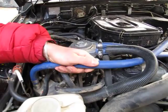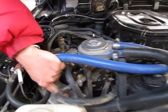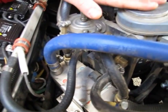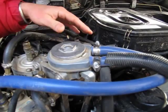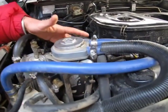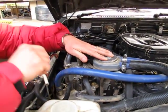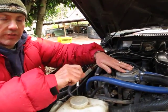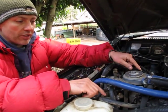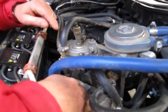Once the engine is warm, I use the coolant temperature from the engine to heat a heat exchanger and also a secondary filter — this is a fuel filter for the vegetable oil — so I always have oil on standby. Once this is warmed up, I switch from inside: I turn off the diesel and turn on the vegetable oil, so now the vegetable oil starts flowing and goes through the heat exchanger.